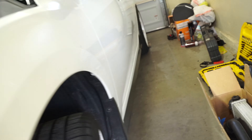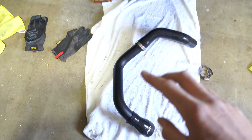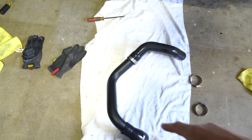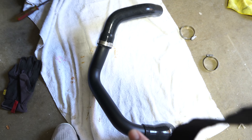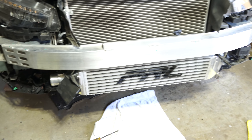The camera did die yesterday — I was fighting this intercooler. The trick is to have it all assembled first and then stick it in, because if you do it in pieces it's so difficult to get in there — it goes in so tight. Make sure you put the bands on before you put everything together. I forgot to do that. Also make sure the longer side of the piping goes over the top, and the shorter piece goes on the bottom. I made the mistake of putting it on backwards and it was a mess.